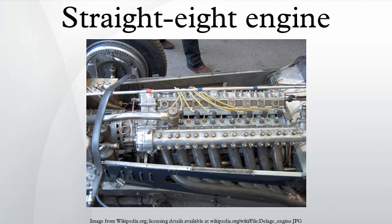In particular, a phenomenon referred to as crankshaft whip, caused by the effects of centrifugal force on the crank throws at high engine RPM, could cause physical contact between the connecting rods and crankcase walls, leading to the engine's destruction. As a result, the design has been displaced almost completely by the shorter V-8 engine configuration.